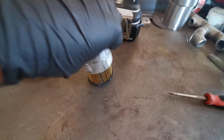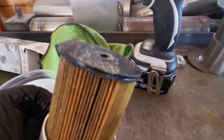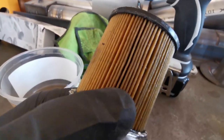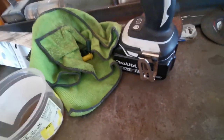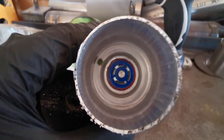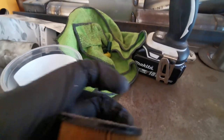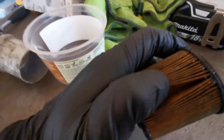There's the end chopped off, and this is the fuel filter. You can see it's not, I mean, ignore the metal parts, that is mostly bits of the shaving where I've cut it around the edge, but it's not massively dirty. It's been doing its job. I'll just put it out there. And that's inside, so you can see where the fuel comes in and returns through there. Nothing really too complex. But I'm going to spread some of these little bits in here. You can see it's quite dirty in there, so yeah, glad I changed that.